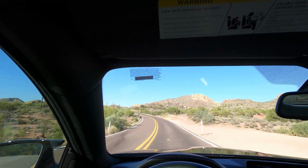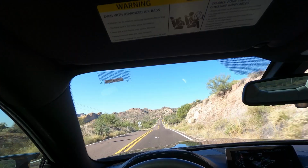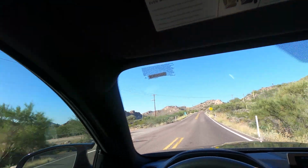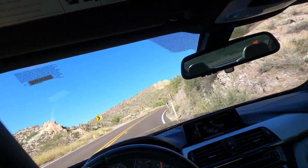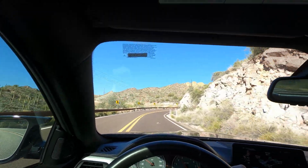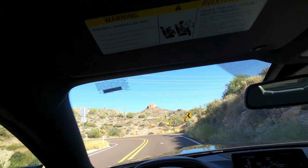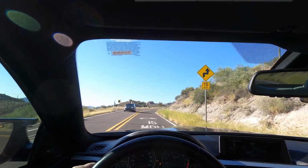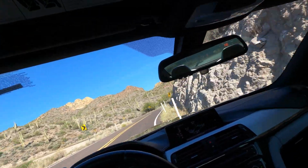But it definitely hides its weight pretty well. I think it's sprung well, and the dampers do a good job with the weight. I think the sway bars are a little bit soft, not too bad. The one thing that definitely needs improvement is probably some poly suspension bushings. I think they do that for noise, harshness and vibration reasons, obviously, because it is a street car. So I might change out the control arm bushings, the front ones at least, to poly, to get a little more feel out of the car. But right now it's very wallowy and boat-like.